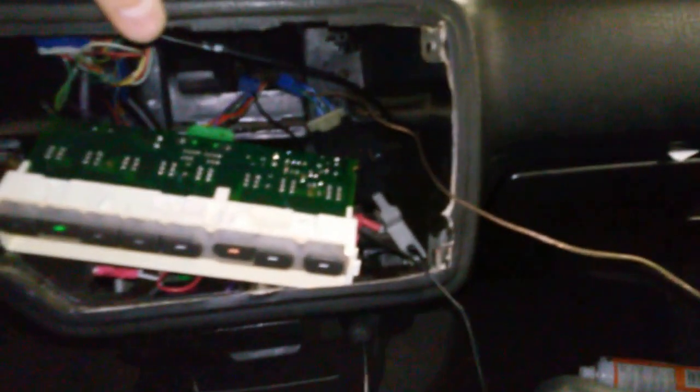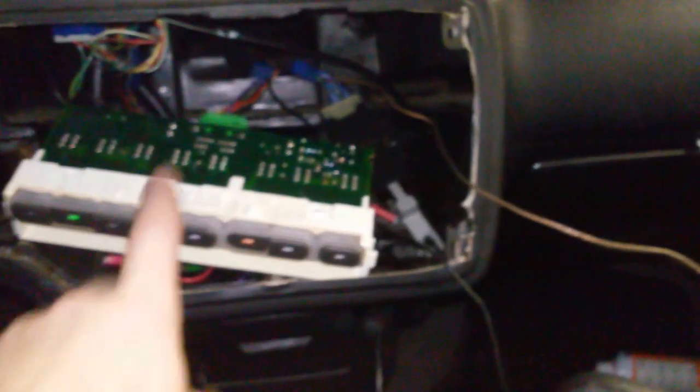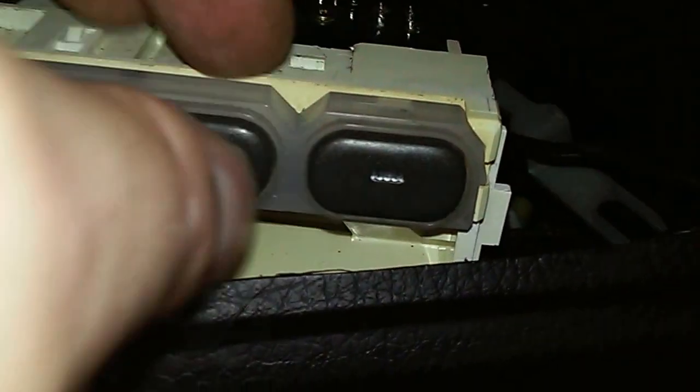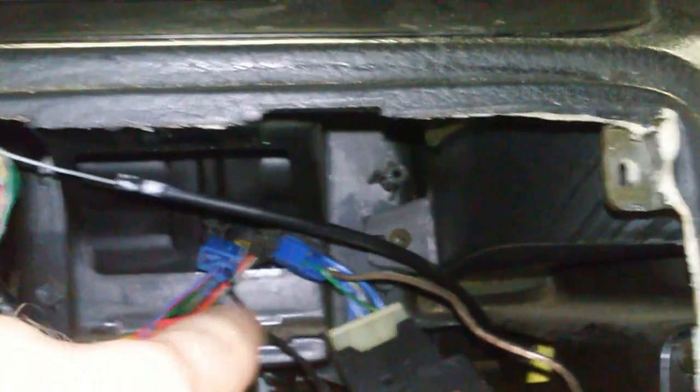So there you go — easy fix for the '92 to '95 Civic air conditioning head unit control problem. If you want to do it right, you don't need to replace the entire head unit. This button still works and you can still see the light coming on and off, but it doesn't matter — it's totally bypassed now. Tap off your blue and red on your big green connector, tap off your green wire, run those wires to your own new switch, mount it somewhere on your panel, and you've got yourself a working AC system. Have a good day.